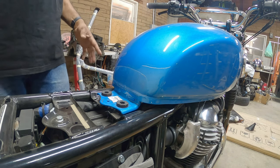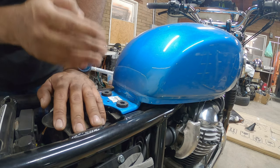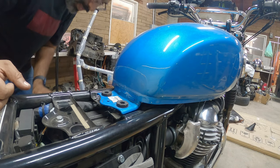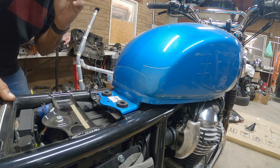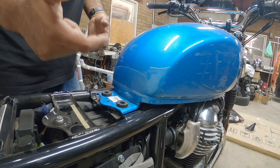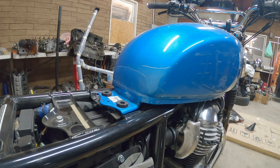My tank is pretty dang full, so I gotta figure out pretty much how to get this tank emptied and yanked out all at the same time. It's not gonna be that easy, unfortunately. I'm gonna probably take everything off and before I yank the fuel line out, pop it out and then put my finger in it and then drain it into a container. Which I have pretty convenient right here. Just a jerry can right here, 5 gallon. Probably gonna empty it into.